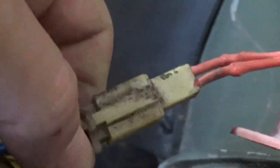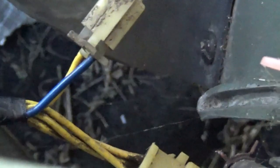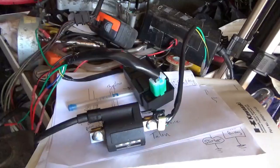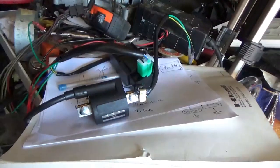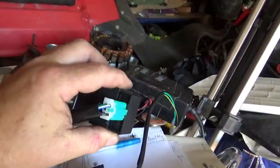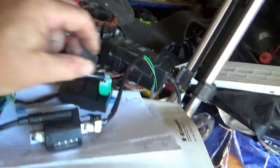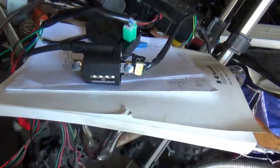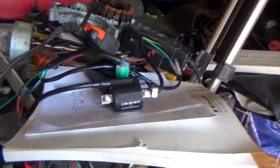So the blue wire — let's call it the high side of the pulse generator — and the yellow wire is the low side of the pulse generator, i.e., ground. So hopefully you've figured out that you're going to plug the 12-volt CDI in here and figured out how to hook up the couple of wires on here, doing everything according to color coding.